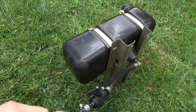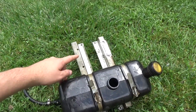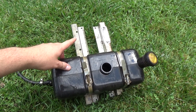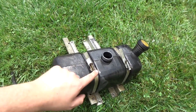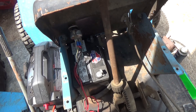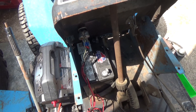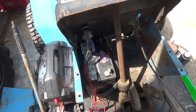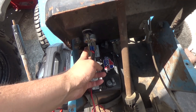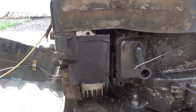We took the fuel tank off and rinsed it out with some degreaser and a little water from the hose. I had to take the whole fuel tank and rails off the frame — just a couple of three-eighths bolts with seven-sixteenths nuts. Getting those rails and the fuel tank off gives easier access to pull out the old battery, which only had about 6.3 volts after overnight charging, meaning there are probably a couple of dead cells in it.